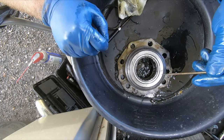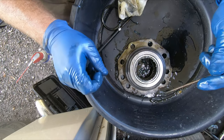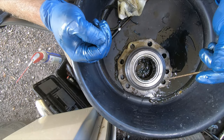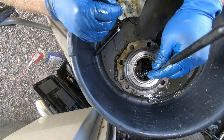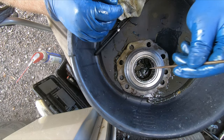Alright, well, you kind of get the point. You got to scrape all the stuff out of there without really damaging the bore, because if you put a bunch of gouges in there, the oil might be able to creep past the back of the seal. Probably want to do this with the bearing facing down so that none of these little tiny chunks get up in the bearing. When we're done with this, we'll have to get this cap off and probably flush this out with brake cleaner.